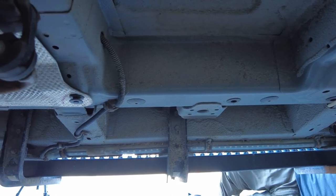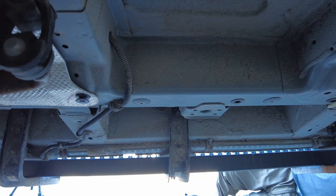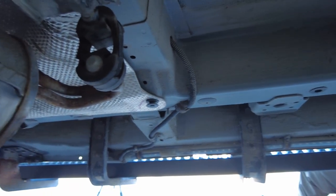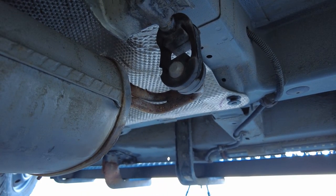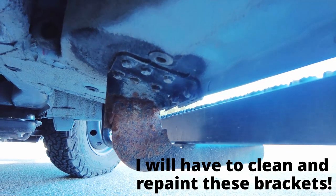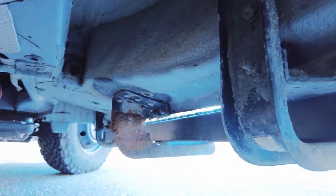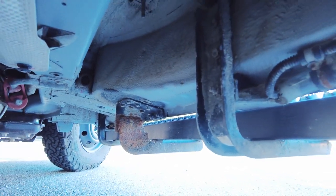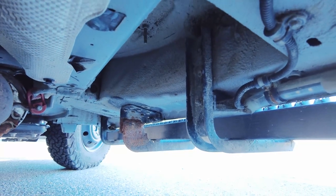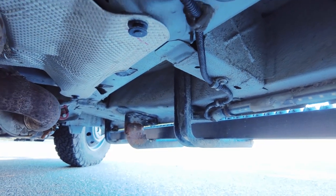And okay, I'm going to stop there because it looks like I'm getting close to the resonator. So yeah, as you can see, it goes right along, and they're simply attached to the bottom of the floor. And of course it was an effort to get the pitch right after we shortened the brackets, and then as you saw, we put the bolt in, and it allowed us to twist against the bolt and set the angle or the pitch that we wanted. And that's how it ended up going in. So anyway, hopefully that kind of gives you an idea of what we did. There we are there.